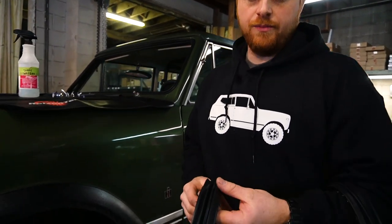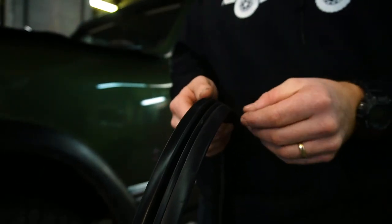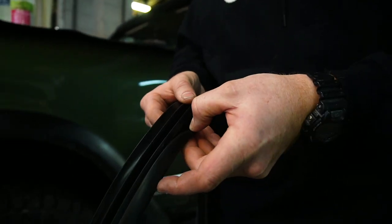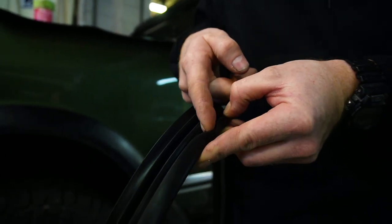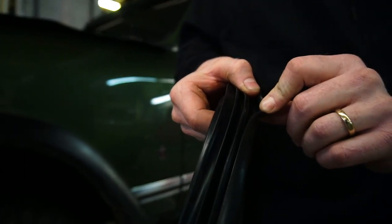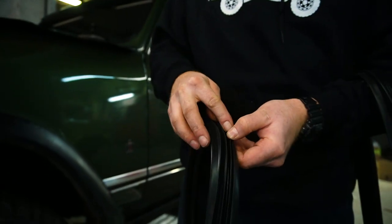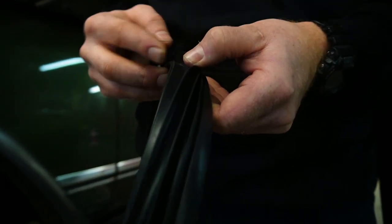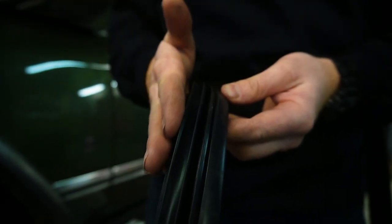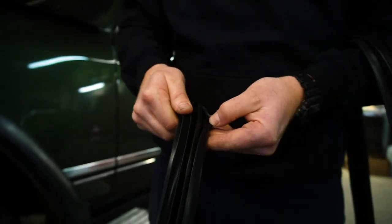I want to explain the seal just a little bit. It's a little confusing looking — which slot do you put it in? What you want to look for is the back side of the seal. This will be on the inside of the Scout, closest to you as you're driving. There's going to be one slot there at the very back — that's the slot you're going to stick onto your windshield frame, the lip that goes around your windshield frame. Don't put it in this slot, don't put it in this slot, and definitely not here because that's the outside. You want this back one — it's more rounded and won't have the extra groove on the outside. That's the inside slot you want.